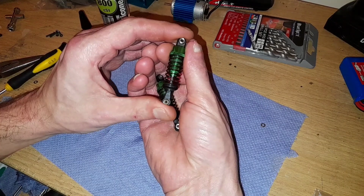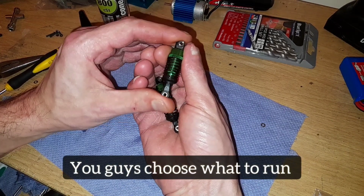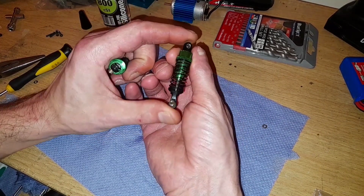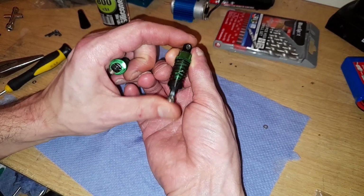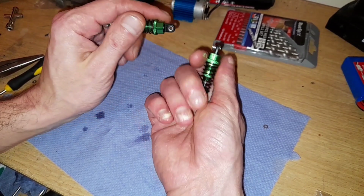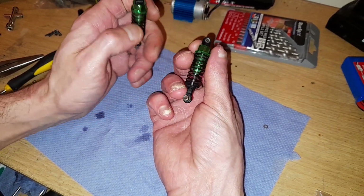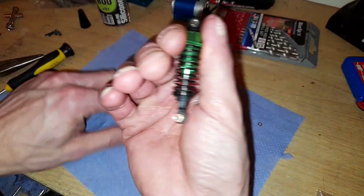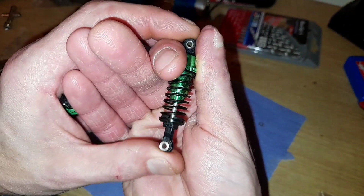I mean, one's got a nice smooth up and down, it feels so plush going up, and coming down's nice into your finger. This one here, you can feel pressure kind of going up, and then it wants to kick coming down. It really does want to punch that spring back down. So I know fine well, even if I was to mix these up, if I hadn't done them, I could probably pick out which one has got Rebound in it. And you can't really tell on camera, actually, I'm sorry, but it's more in person that you can.